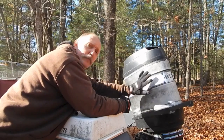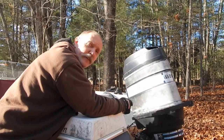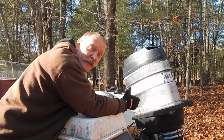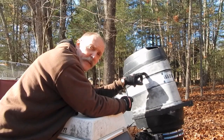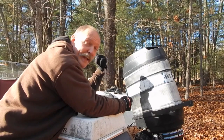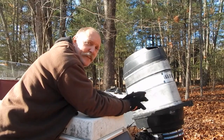So for the time being, I'm leaving my wire disconnected because I don't know which tachometer I have up there. I don't know whether that's an original old tachometer that might actually be good and has to have the wire hooked to the switch box connection, or a later tachometer that somebody stuck in this boat and it never worked because the guy didn't realize it needed to be switched over to the alternator. Too many questions, so we're just going to leave it disconnected for now.